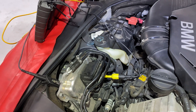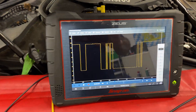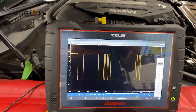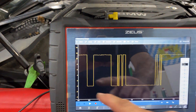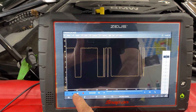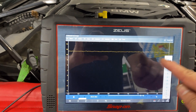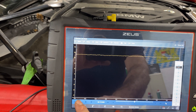It looks like it is a straight wire from here to the back, and then the other DME is on the other side. I went ahead and plugged this in and now the code erased. This is the diagnostic wire for the NVLD. It's a 0 to 11 and a half volts signal. This is actually already recorded. It's only active when it's looking for diagnosis, so it's not a constant communication.